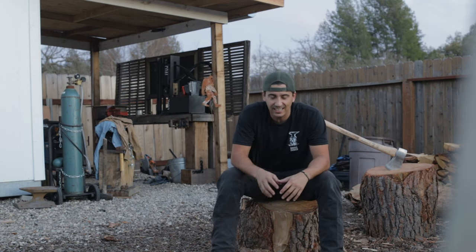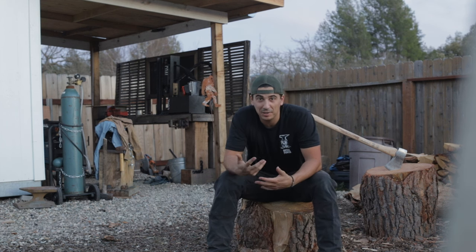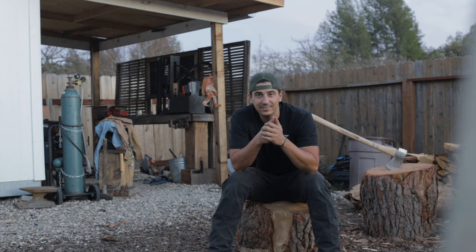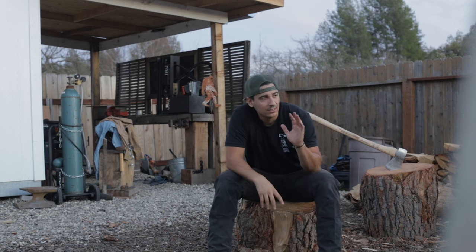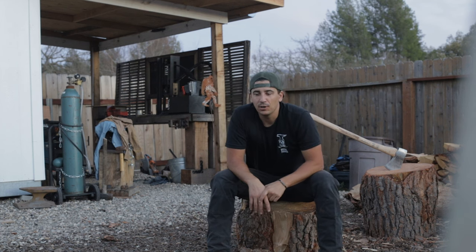All right, so got the rocker panels done. I got the floorboards done. Obviously the rocker panels took a little longer because I had the whole crew cab to do all the way down. There was some foam insulation in there and stuff like that, but I got it all out. Got it all re-welded, stitch welded, ground out. It's ready. So it was a lot of fun.